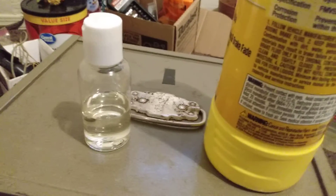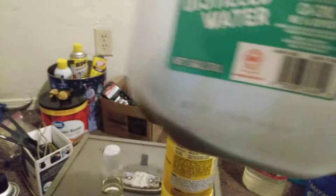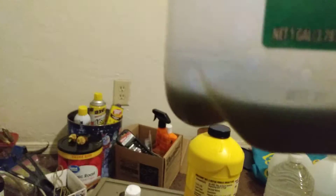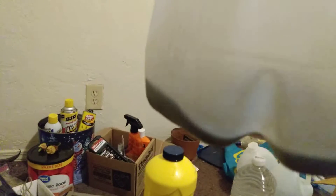If yours is dirty — mine is — I pumped the reservoir dry and got this fluid out of it. That's probably the factory fill. I need to bleed the brakes; it's super dirty. The inside of the reservoir is dirty with little flakes of something in there. If yours looks like that, it's time to give it a flush.